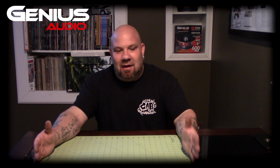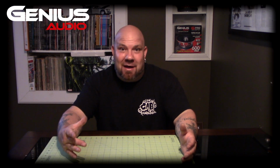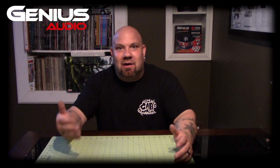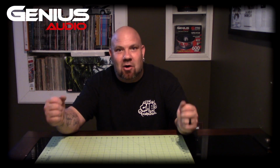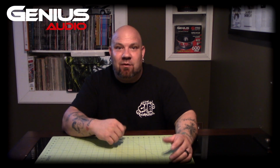The ends, the power supply end was getting very, very hot. I didn't realize there was a fan on the bottom of it. So I elevated the amplifier, the fan was able to actually circulate the air and it dropped the temperature and was running a lot better. So that's something you need to realize. Don't just screw it to a carpeted panel. You're gonna suffocate that thing and it's gonna be very unhappy if you beat on it.